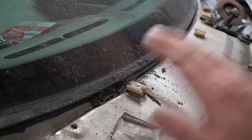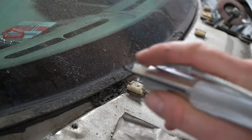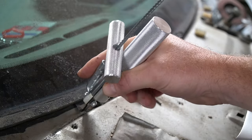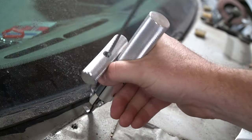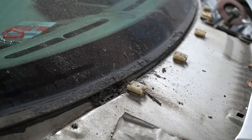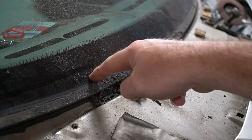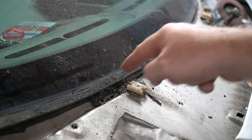Sometimes you need both tools, and here's a good example of why. With the cutter I prefer, if you press it up in the bottom area, the seal doesn't start until maybe half an inch in — so even shoved all the way up, I'm still not cutting all the way through the seal. Unfortunately the seal is up high and this tool just won't reach it. So what I end up doing is using the cutter all the way around the window except for the bottom, and using the steel rope saw to cut the bottom out as I work my way around.